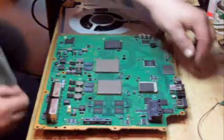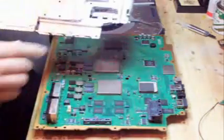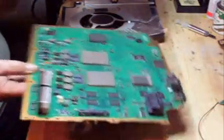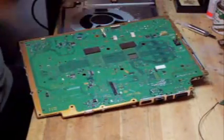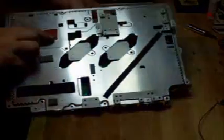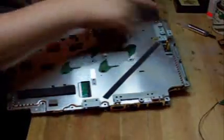Once you get your coating on there you can start to assemble the motherboard. This is where the video output and audio output and stuff go through. You take it like so and line up the ports so that they fall in there. There are two little pins right here — you've got to make sure that those pins are in the holes. Take the other casing and hook it into the little tabs on the bottom. Make sure you get all three tabs in there, and you sandwich the motherboard in there again. Make sure the two little pins in the upper two corners go through.